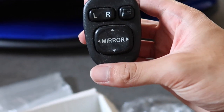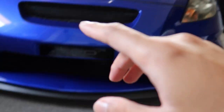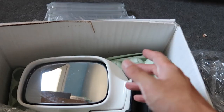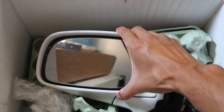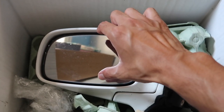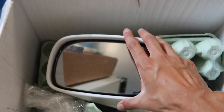I did some research and they're saying that to have it working properly — because these are for right-hand drive cars and this is going to be on a left-hand drive car — I'd have to reuse the mirror bases on the left-hand drive, which are these right here, and then switch the top part over and then switch the left-hand drive mirrors onto the power folding ones.